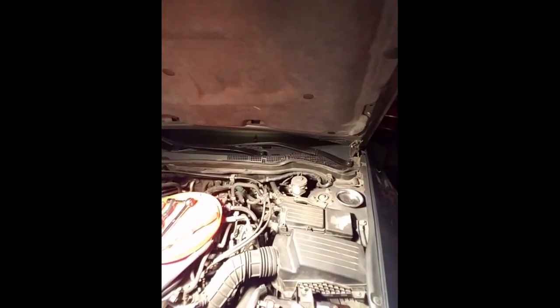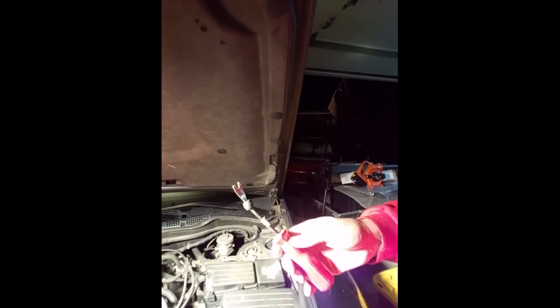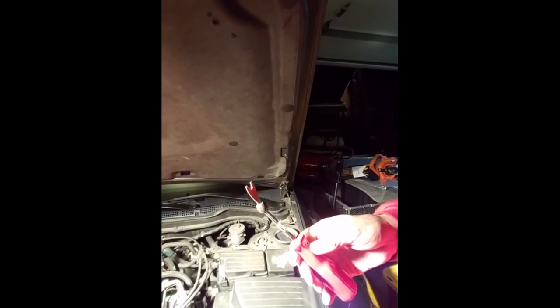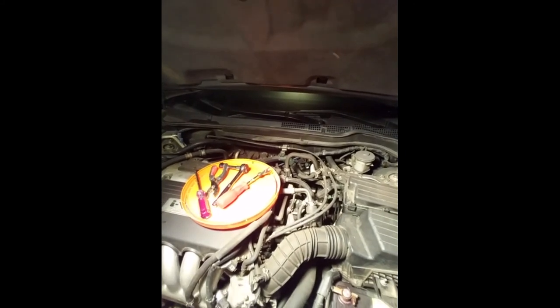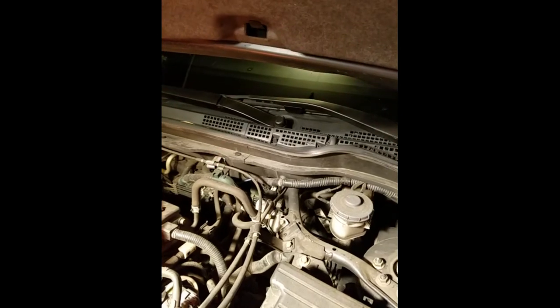Here's some basic stuff to get started. I love this little flathead pry tool — it's much more effective than a flathead screwdriver because it really helps you pop plastic rivets, buttons, or clips without damaging them. On these Honda Accords they're everywhere. I've also got my little magnetic ashtray, a couple of tools, and a 17 millimeter socket so I can pull the windshield wiper arms off first.